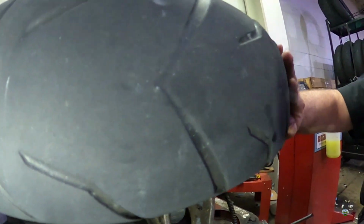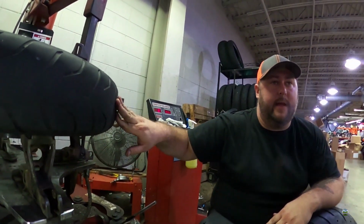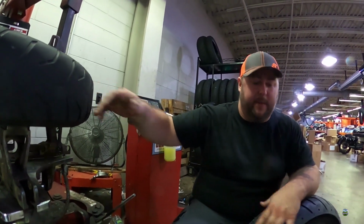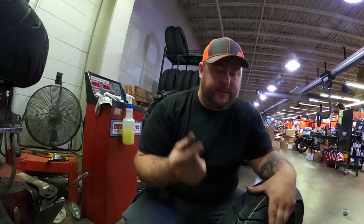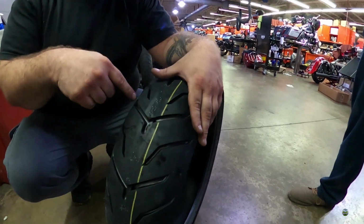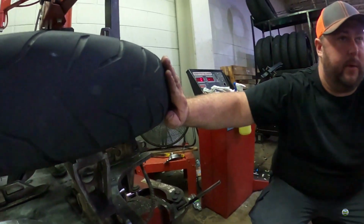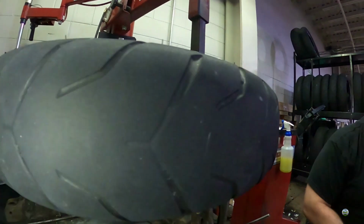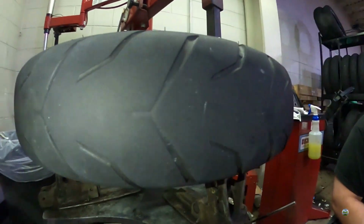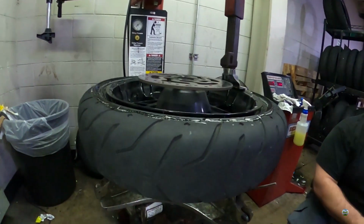Now the other thing that happens. Oh, wow. When the tire gets like this and gets worn, it's a lot easier for things to penetrate it. So if you pick up a nail or something you might not have noticed, or say it was a small one, the tread's sticking up on this tire to where maybe it doesn't go all the way through the tire. Whereas on this one, it's going to go all the way through. Man. Oh, my gosh. I was going to wait till I come back from the Key West trip, but my guy Papa D was like, definitely not. You should go.